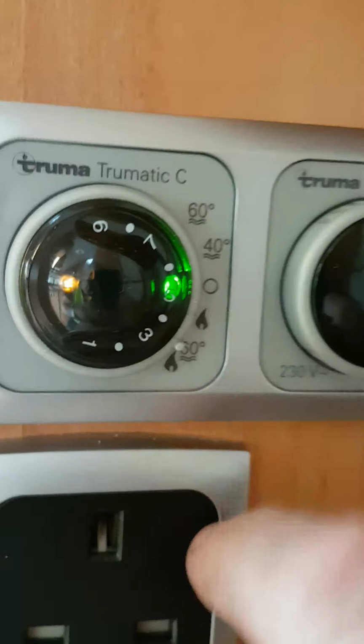What we're looking at on here now is this red valve. This is your frost valve, and how this operates is it retains the water inside the heater. And at 2 degrees, this wee valve here will drop down like that. I'll just pull it back up again. Once it drops down, it'll drop down itself automatically at 2 degrees. It'll start to drain all the water out of the heater. And what that does is it protects your heater from frost.